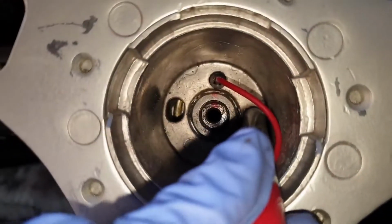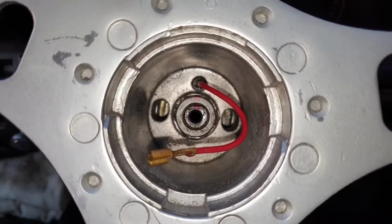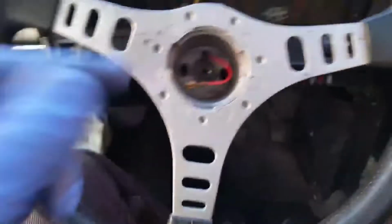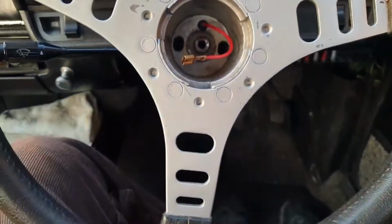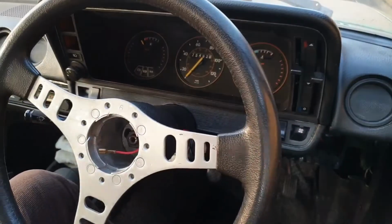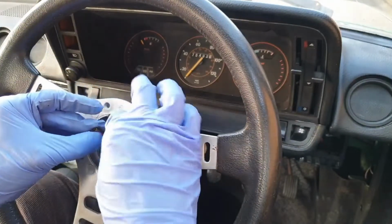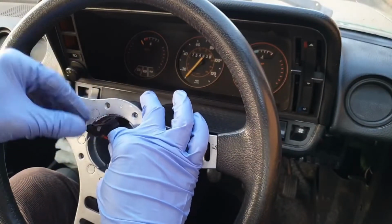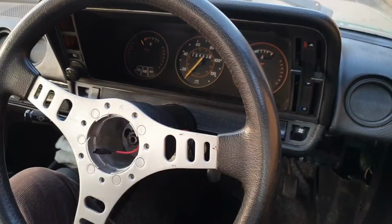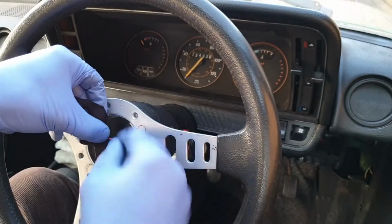You've also got these two holes here that I could put the gear puller in for next time, which keeps everything a bit closer and neater. There's even a GM Vauxhall specialist tool for removing steering wheels that utilises these. Now I need to temporarily tape up this 12 volt horn wire until I get the horn push wheel centre. Doing a neat job of this is completely optional.